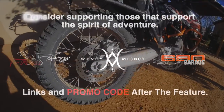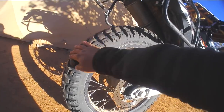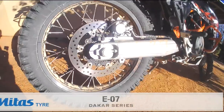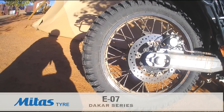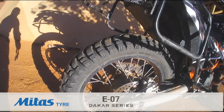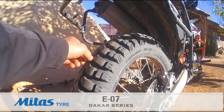Tire selection. I try to run this tire on every bike I have and will ever have that fits. It's the Mitas E07 Dakar. It's a 4-6 ply tire. It just holds up phenomenally. This is 2,000 miles so far, and I'm just now down to the center rib.